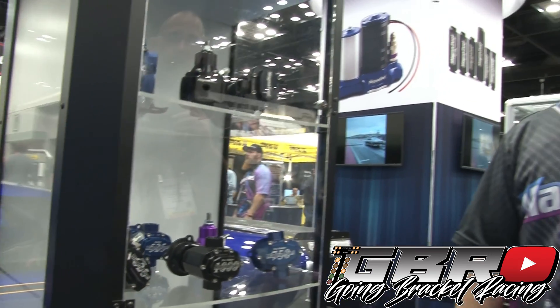Right, because my overall issue was the 500 pump — if I run 20 pounds of boost, when you're boost referencing it, that means you have to run your base fuel pressure plus whatever your boost is. Correct, yeah — so if you're making 20 pounds of boost you're essentially at 28 pounds. The 500 pump is only rated at about 28 pounds, and if you're going to be running methanol at higher power you're going to want more volume, so the EFI pump will be able to keep up at the higher pressures and put out more volume.